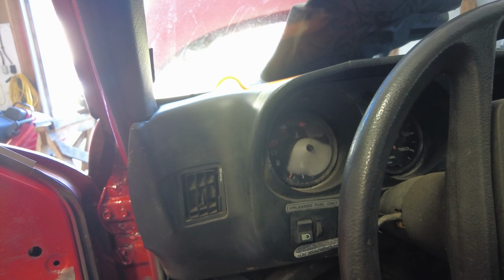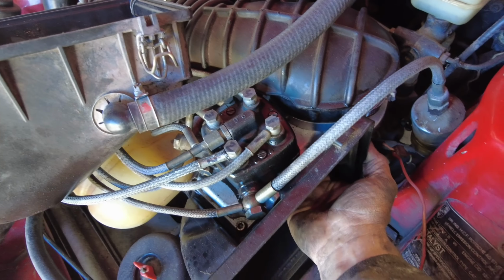Put that right where it was, eh? Barney's barking away up there, wanting to be out. Give it one more crack here and see what happens. Well, actually what I'll do is put some fuel through to the system there, right? You can't really see what I'm doing, but I'm pushing up on that plunger in there. See if that'll get some fuel into it. Nothing. Do I have it flooded now? I don't know. I think it's a cold start.